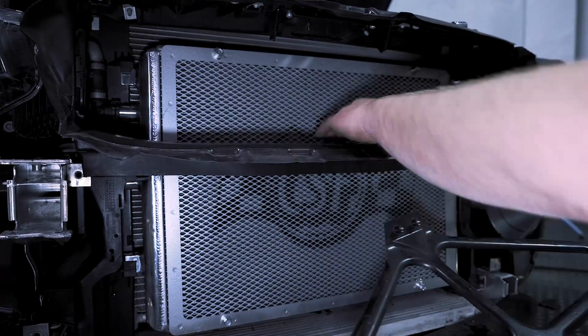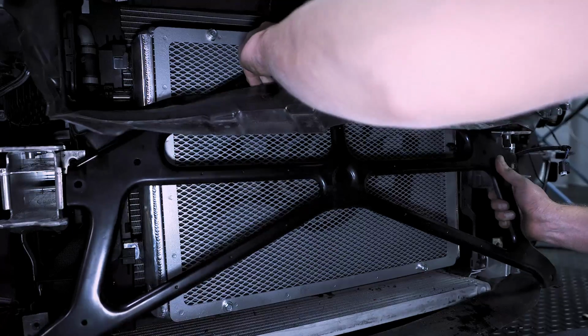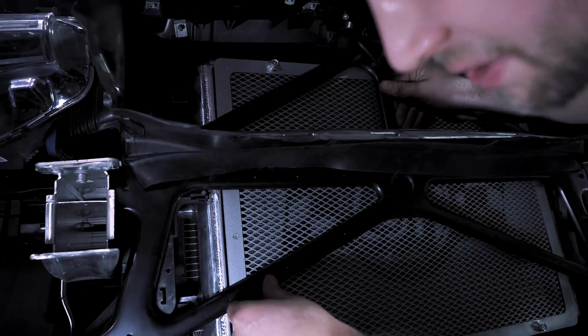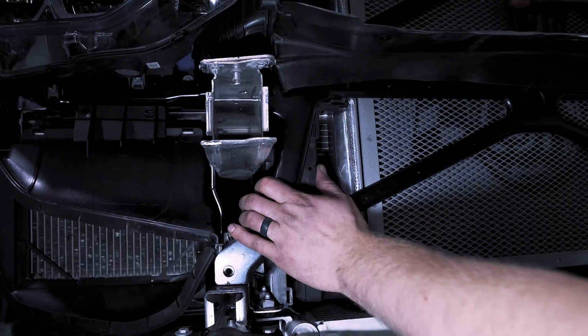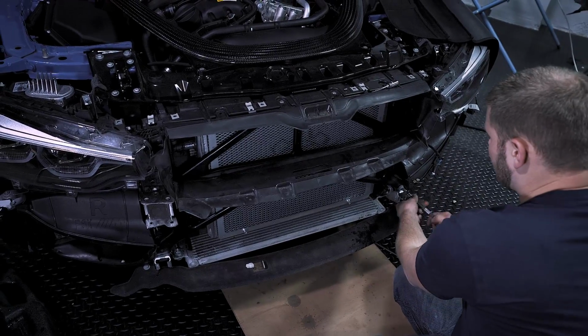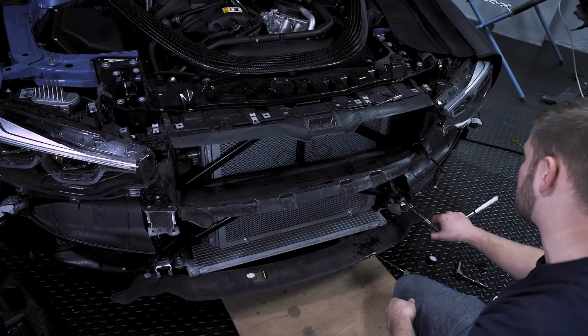Now we're going to install our front brace. So just very carefully guide this up here and slide this into place like this. When you're doing this, you want to make sure that you have these side pieces of plastic installed first. You don't want to forget about that. Then you can secure all of these T45s, and we'll have the torque spec in the description below.